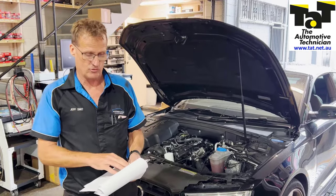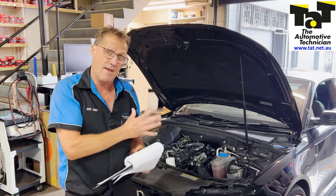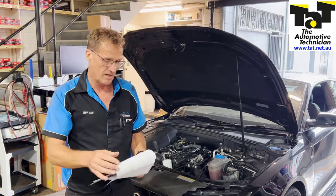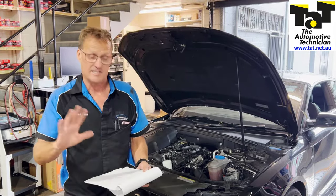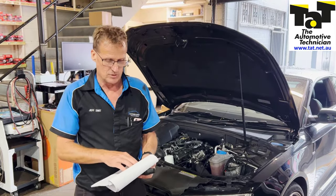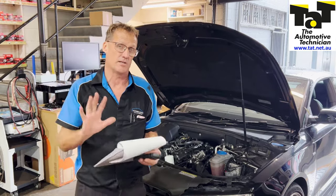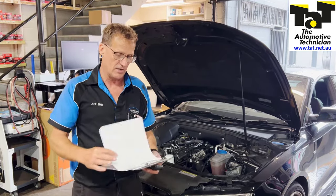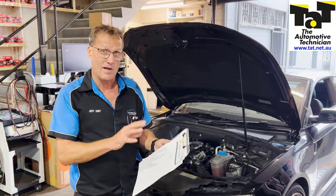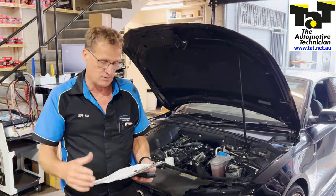It's the 2 litre turbo petrol motor, which is the CDNC, but a lot of these family of engines — Audis, VWs etc — suffer from this particular problem in this area. We've scanned the vehicle first up and we're coming up with a code of P261A00, which is the coolant pump number 2 open circuit. We've got another one in a similar situation on a Volkswagen — different engine but same fault code, same sort of issue.